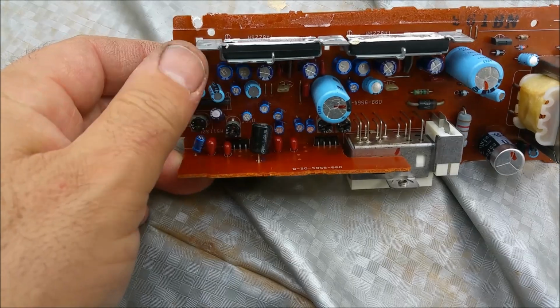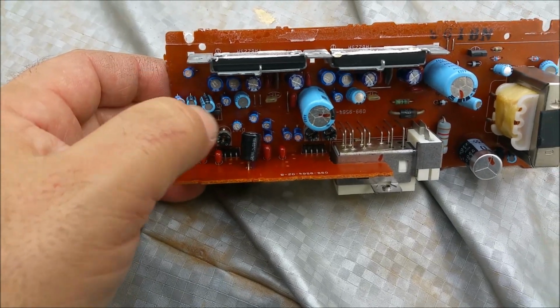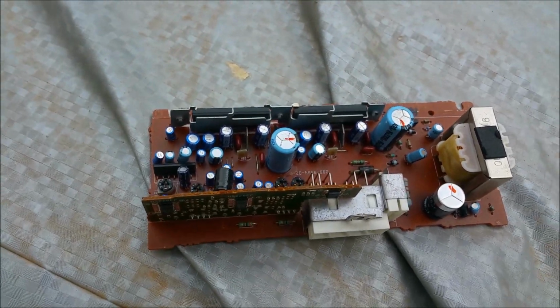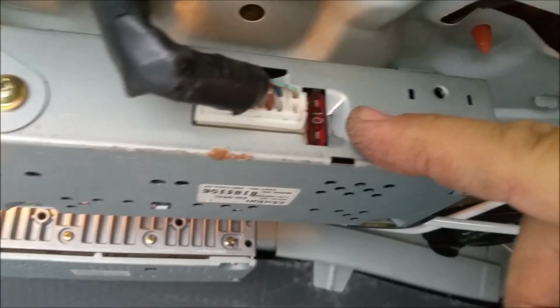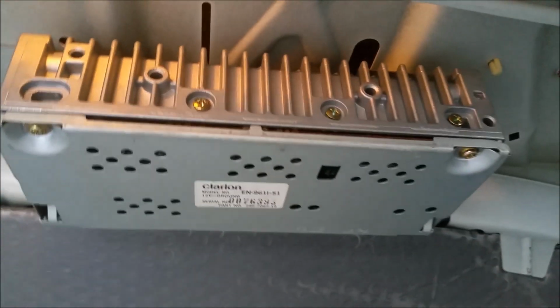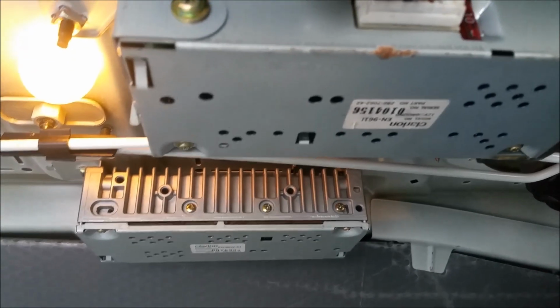These are the little Toshiba TA8225H amplifiers. Each of those is 45 watts. So for an OE system, it's brilliant. When you look under the parcel tray on these things, you've got that one there. That's your front amplifier, and that's one I had that I've changed over. And there's your rear amplifier there. So Nissan have put 2 amps under the parcel tray.